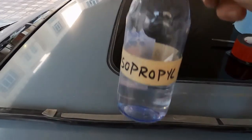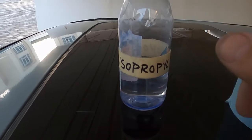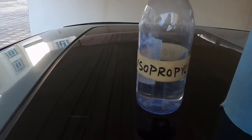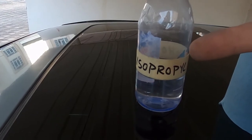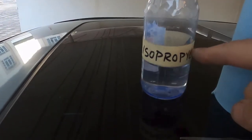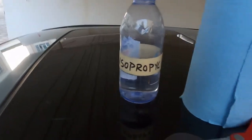After I get this tape off and the other side corrected, we're going to take a nylon brush and brush all this dust out, get this as clean as humanly possible, and then do a wipe with isopropyl alcohol. Also, proper labeling needs to be addressed — if you're going to take something out of the original container and put it into a secondary container, make sure the plastic is rated to hold whatever you're putting in there, and label it. It's not hard. That's your safety tip.